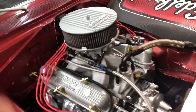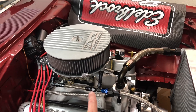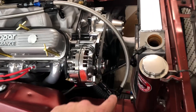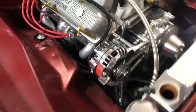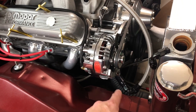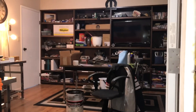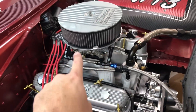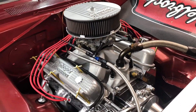I still do need to upgrade this line — that's a dash-6 and I did this just temporarily to get through racing season, that's why that little blue fitting is there. That will be gone. That's a dash-8 full line down to my mechanical pump — an Edelbrock mechanical pump, by the way — and those are good to like 600 horsepower, which I've pretty much proven. I've got a little filter on the end and then 90 up. I do plan on swapping this out to get a proper one for this carb and delete that blue fitting, and then it'll all look really cherry.